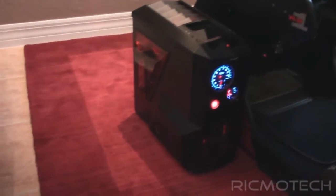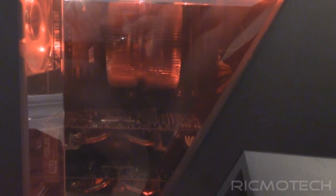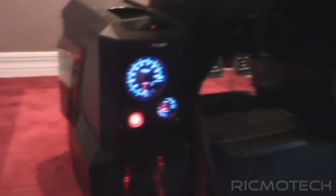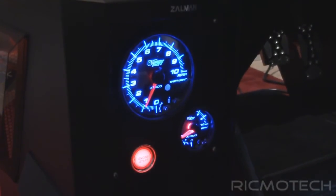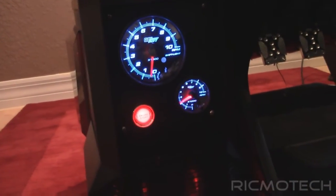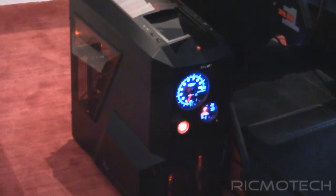For this one I wanted to do something a little bit different. We build high performance PCs all the time, but wanted something that showed it was more specific to Simracing, so I wanted to customize it a little bit. I came up with this idea of putting a couple of tachometers on the front and an engine start button, and these are linked to a little microcontroller that plugs into the USB port. There's a little piece of software running in Windows that drives them, sending it the signal to indicate processor load and also processor frequency.